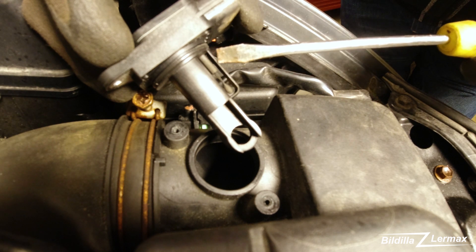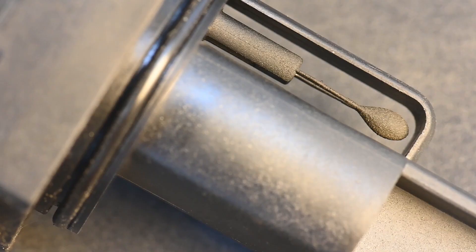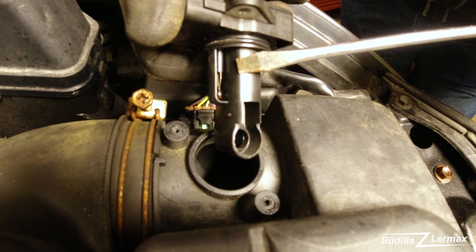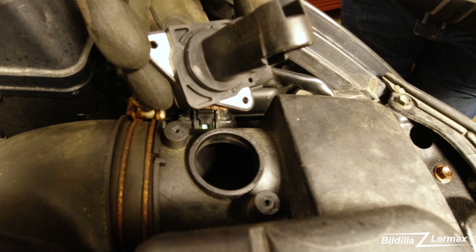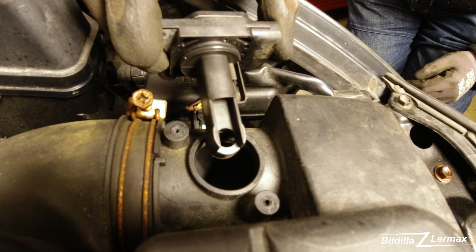Two screws, take out the sensor. You can see this sensor, like the other ones, is filled up with carbons or dirt that came through the filter. This one is dirty and needs to be cleaned. I'm going to put in a picture from the other one, because this sensor is more or less the exact same as in the Land Cruiser and the Camry. On the Land Cruiser it was bad too. Up here are the temperature sensors — those are a little dirty but not as bad as on the other cars. This one is not good at all.